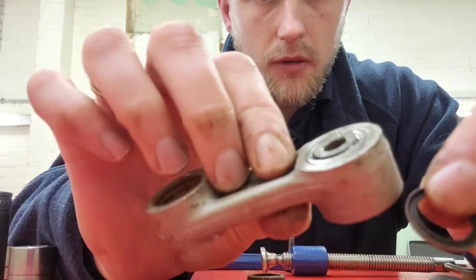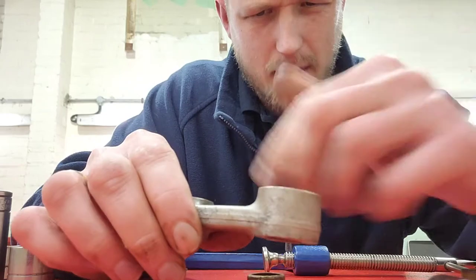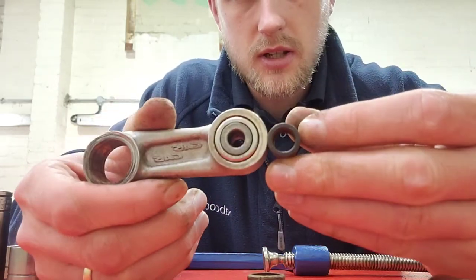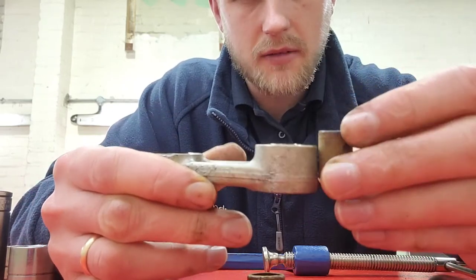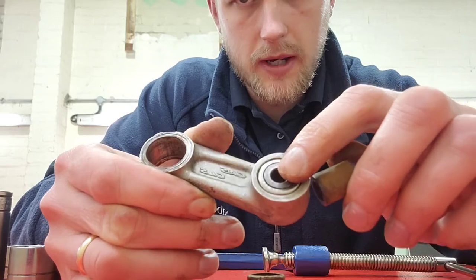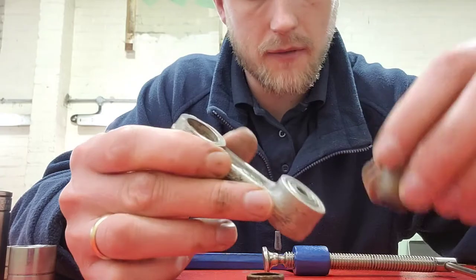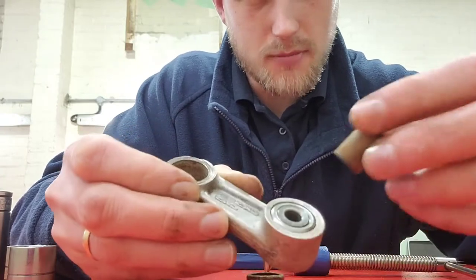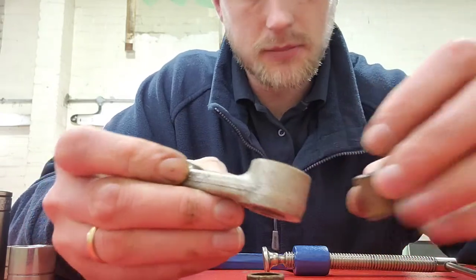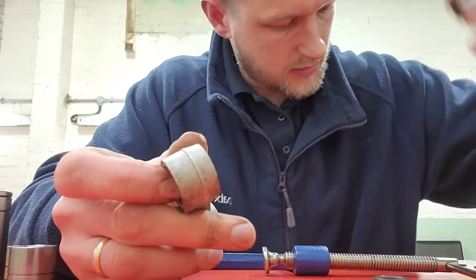As you can see, the one I did before - the bearing is flush with the body of the dog bone. I do them one at a time rather than taking them all out because the hole in the center of the sleeve is slightly different depending on the side - the bottom has a smaller hole and the wider hole is for the upper part of the suspension. Just make a note of that, though you can always pop them out and swap them around.